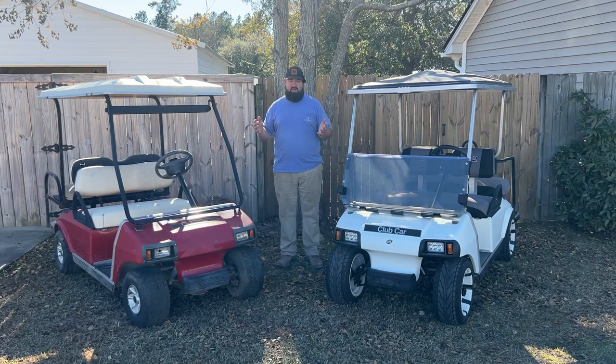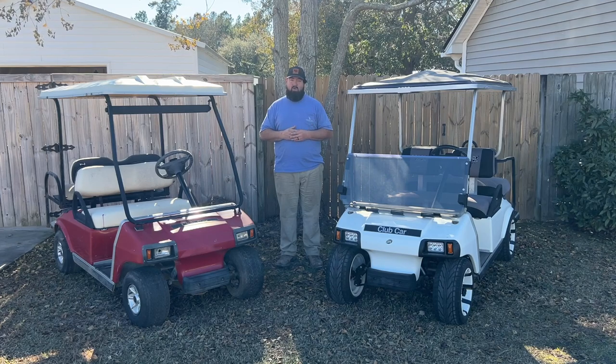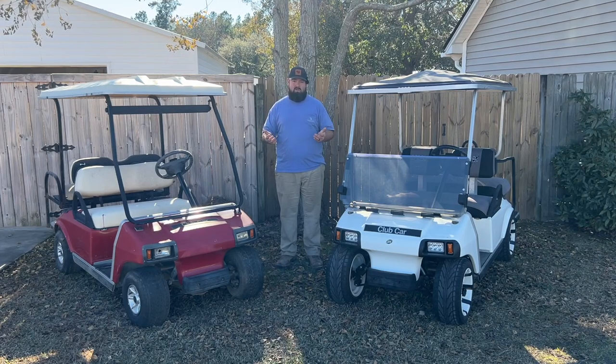I hope this short video helps you out if you're looking for a golf cart to build, whether it be a series cart or a Sepex cart. And this is just the Club Car DS platform. In the EZGO TXT platform, it's the same way. They have a series EZGO TXT and they have a Sepex EZGO TXT. I think it's called the PDS. And they also have a DCS. We might make a video on that in the upcoming future as well, if I can find two of those carts to do a video on.